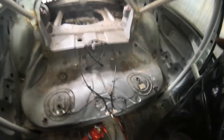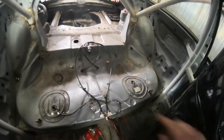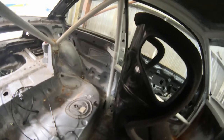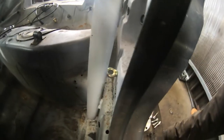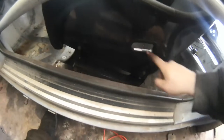You can now see where those two little eyelets are at the rear. There's one here, one there, one there, and one in that corner — they're all factory OEM seatbelt mounting points, so they're perfectly fine to take a harness eye. I'd recommend putting a bar in the cage from main hoop to main hoop at the right height, but I don't have the tube to do it right now. The final harness eye point is just down there — also an OEM seatbelt mounting point, so that's fine.